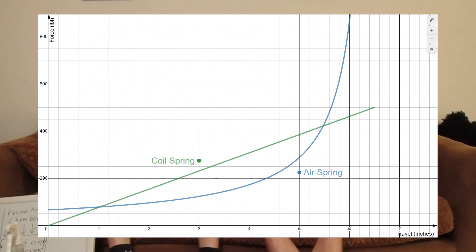One other thing that's not exactly intuitive is that you have to have good mid-stroke support in order to have a truly progressive shock. This chart shows that a wallowy midsection where it flattens out and looks progressive actually ends up in the same spot as this coil spring. However, if you support the mid-stroke, then you can create a ramp up after that which resists bottom-out while still providing mid-stroke support. Well, thank you all for joining us today — it's been great talking about negative air springs. Feel free to like our video, comment, or subscribe, and head to our website MTB.Dev for all sorts of useful information and calculators to help you set up your bike.